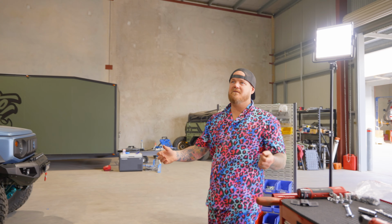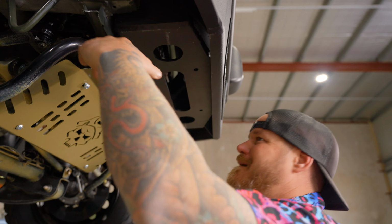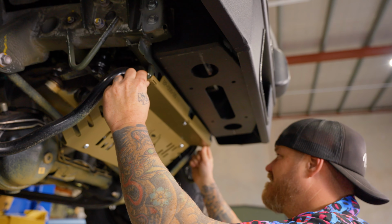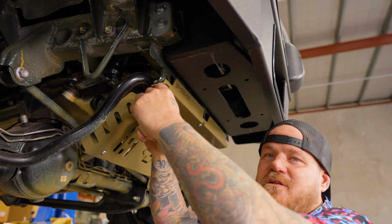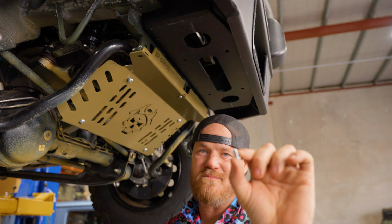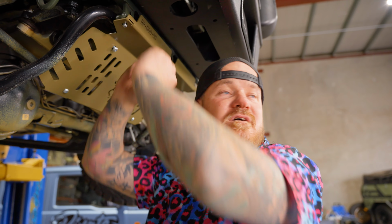So from memory, normally, because this guy's got a bull bar on, normally there'd be a bumper here, right? And that bumper would be bolted on with these 3 points. So obviously I couldn't show you that bit, but from memory, just undo the clips or the bolts holding the bumper and you just drop it down and feed them in. You wouldn't need these 3 bolts. You'll have factory bolts there to reuse. I'm just putting these in because this guy's got a bull bar.